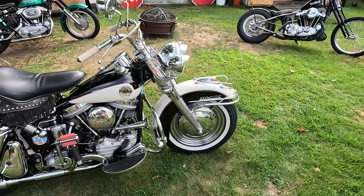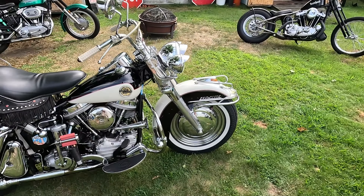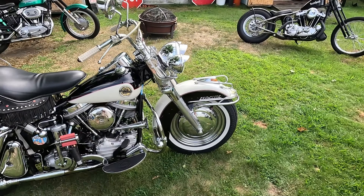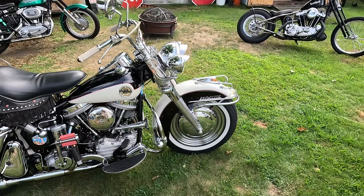Alright, got Tommy's clutch. I'll adjust it at the clutch — you turn it counterclockwise half to three quarters of a turn, then you set the free play up here to an eighth of an inch. You can use a nickel — stick a nickel in there.